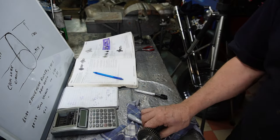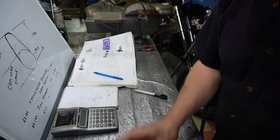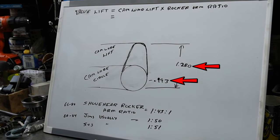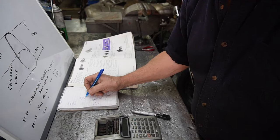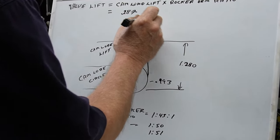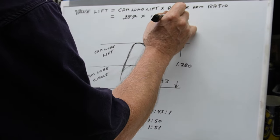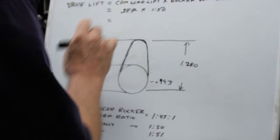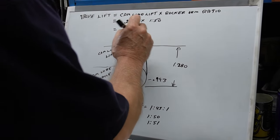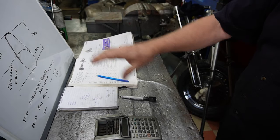Now that we have those figures we can get a rough calculation of where we're at. I'll take my 1.280 minus 0.993, which equals 0.287. Since this is an '80 and up, I'm going to use the 1.50 rocker arm ratio — so 0.287 times 1.5 equals 0.430. Looks like 0.430 is our cam lift according to our calculations so far.